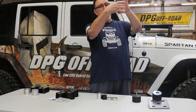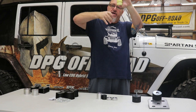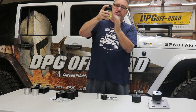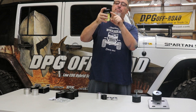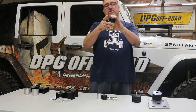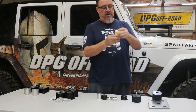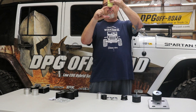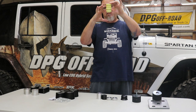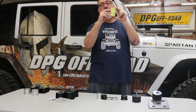When the suspension droops, the coil spring is around that bump stop and the control arm angle swings down, pulling the spring back so it can run against the bump stop cup. I'll grind the front lip off that cup so the spring glides through. That long poly bump stop hangs up more in the coil when it droops. So I like the stock length, stock style bump stop on the front of these Jeeps. Also, the compression of the factory bump stop gives you more travel than you think — when someone says they've got this much gap, there's actually more travel because of compression.